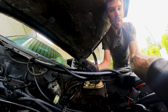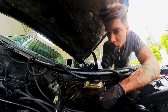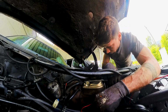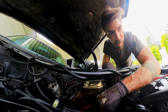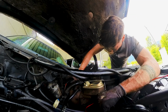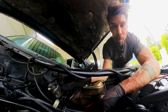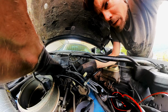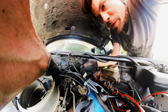What about the purple wire here? I guess purple should not have ground. But it does. So somewhere this color is grounding out. Question is where. So what am I missing? This is connected to the battery cable. So just for now I reconnect the cables so I don't lose track of which cable went where and which cable I have already opened.